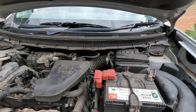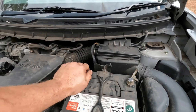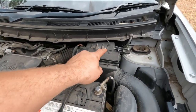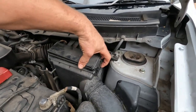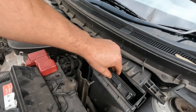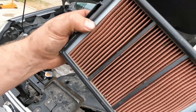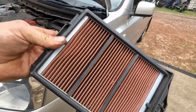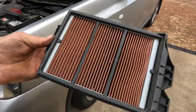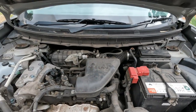From there, move over towards your battery and have a quick look. Make sure it hasn't got any corrosion around it or loose terminals — give them a shake and make sure the battery is secure with this clamp here. From there we can move on to the air filter, which is just a clip on the side — pull it up and pull the air filter out. Look for big bugs or debris. These are cheap to replace, but for now give it a tap on the ground, get out whatever needs to come out, and we'll replace it next service.